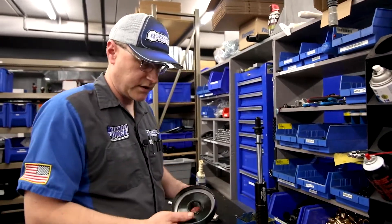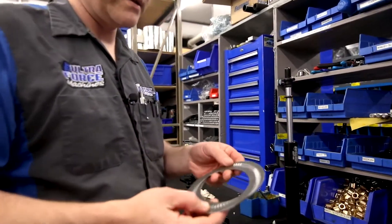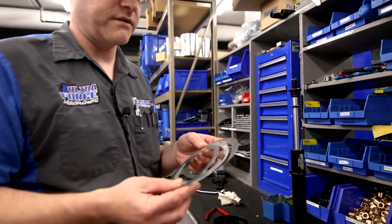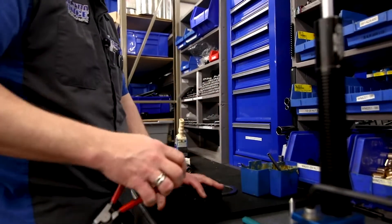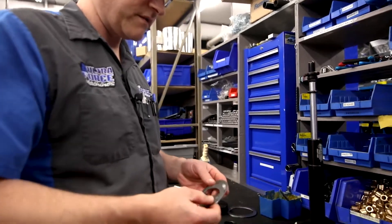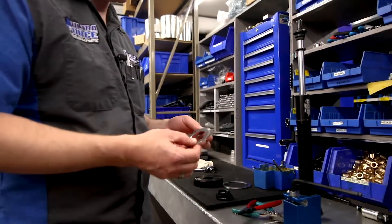On the cup side, if you're running the five-inch Torrington bearings, you're going to want to take these apart and clean them at the same time you service the slider — about every 10 races. There's also a Torrington bearing on the nut side that needs to be taken apart and cleaned at the same time you're servicing the sliders. So there are a lot of bearings going on in the slider, a lot of things to keep clean.